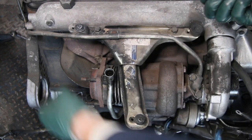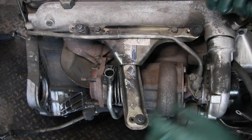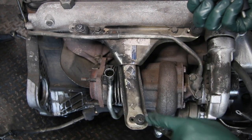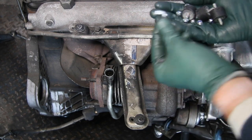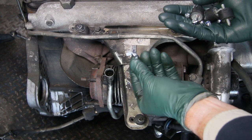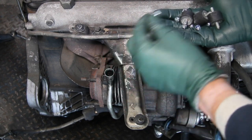I found that if you provide a locking nut at the bottom to keep this from loosening up, you'll save an enlargement in the hole problem right here. The other thing we do is provide you with a new wing nut for the top of the air filter housing cover that's often lost.